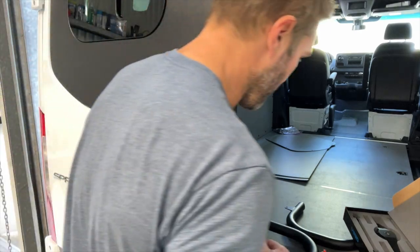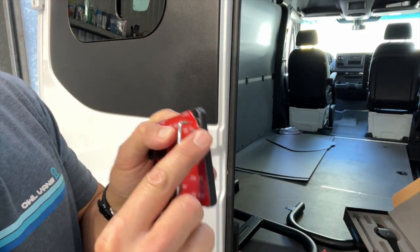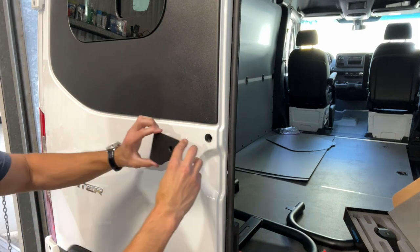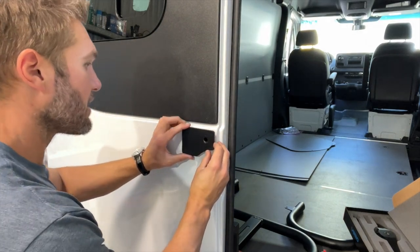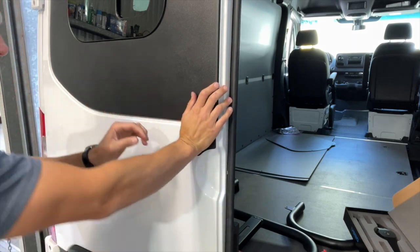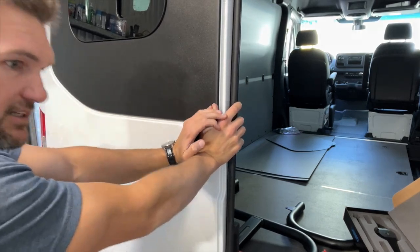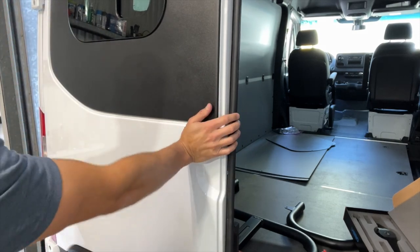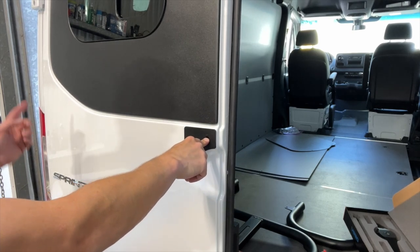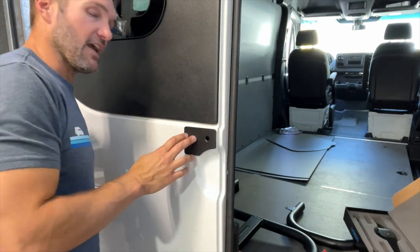Take the 3M backing off — easiest thing is if you have an exacto blade or sharp tool to get that plastic cover off. Then it's kind of an eyeball — put that slug in first and make sure it's pretty even, then press it against the van. Don't press super hard because the outside sheet metal is prone to denting. The inside is what carries the load — this is really just spreading things out on that sheet metal. The main carrier load is going to hit that inner structure, and by design, the vast majority of the load is on the hinges.